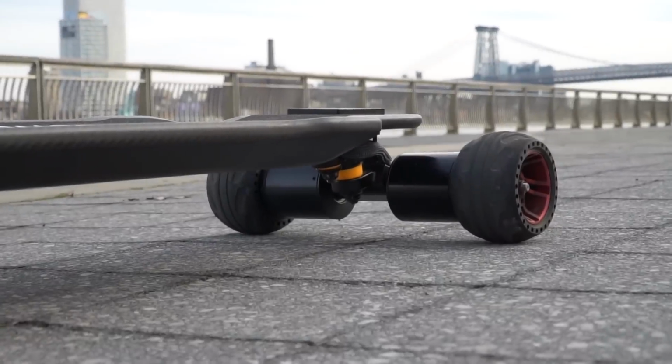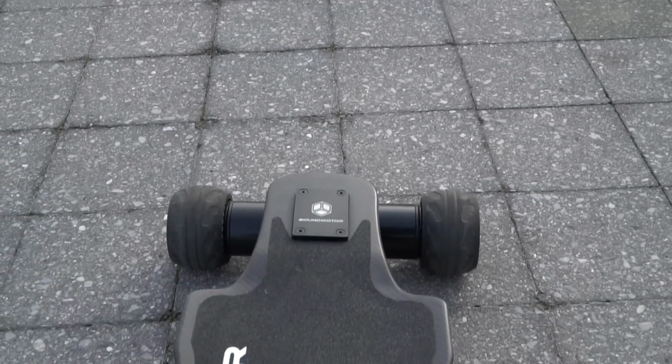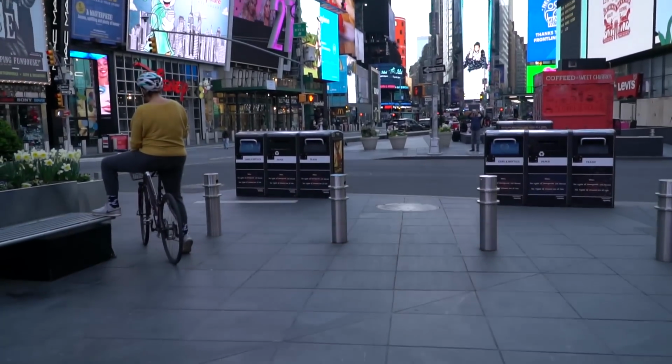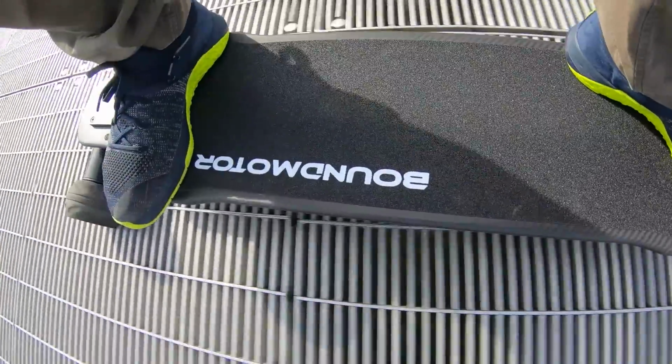Direct drive comes with 3000 watt power output. It looks massive and well integrated onto the hanger. It is super silent. Now, out of the box it is set to have a powerful start, but when you get close to 20 miles per hour, acceleration slows down a bit until you reach the top speed, which is about 25 to 27 miles per hour. It feels more gradual with my weight with 27 amp discharge per motor.